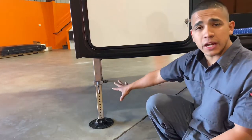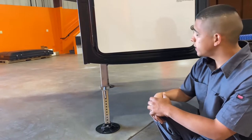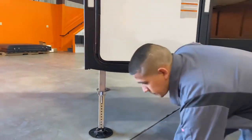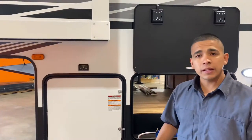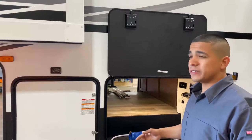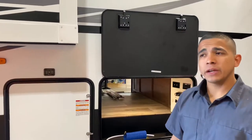You have an electrical part of your leg controlled with those two arrows, and the rest of the leg is mechanical — you'll have to do by hand. You'll pull this pin and drop your leg there. When I'm unhooking from my truck, I always drop at least six inches electrically and then the rest with the pin leg. You can get blocks to save your jack a bit and make it easier to unhook, especially if you're at an incline. All I have to do is hit auto level and it'll do the rest — it'll start with my front legs, then drop my back legs, and once they're down it'll start to tilt left and right to get to the right position.